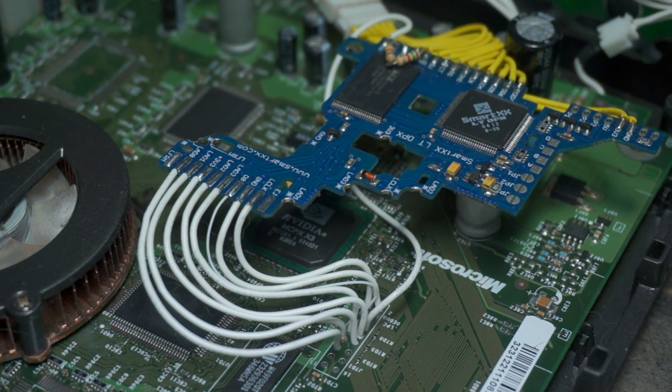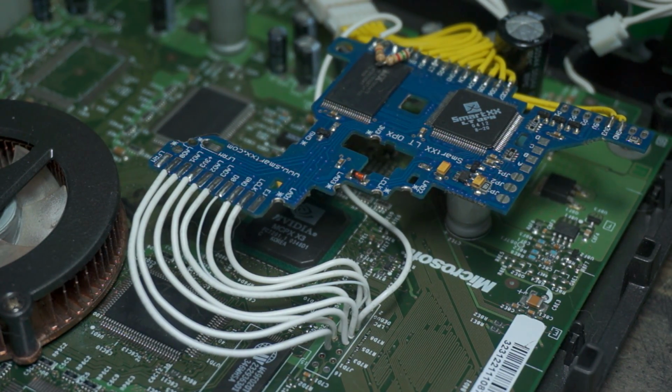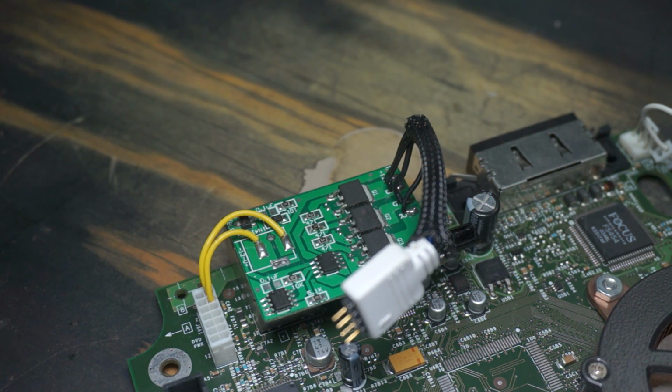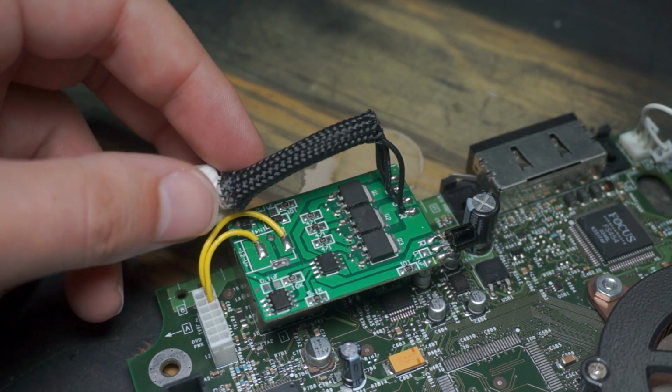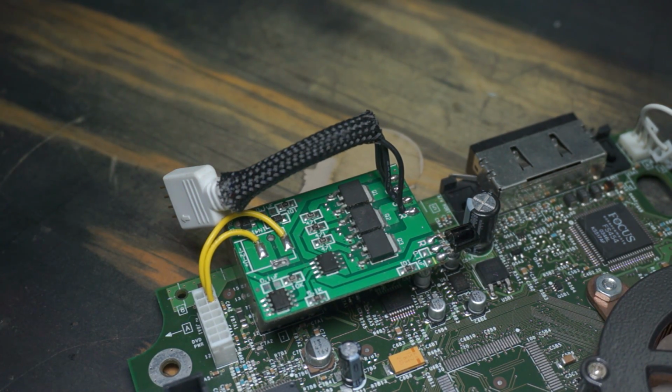You might be wondering what those two resistors are doing. This particular chip was sort of a budget option, so it didn't come with a potentiometer to adjust contrast. And since they are just adjustable resistors, this works fine. One thing on the top of the motherboard I didn't talk about is my LED controller. Nothing special. It takes power from the DVD drive connector, and the lights can be changed with the remote that I didn't show, but I always just keep them blue, but it's nice to have options.